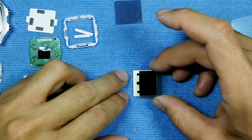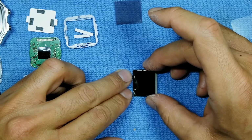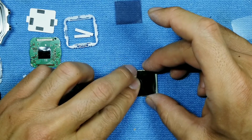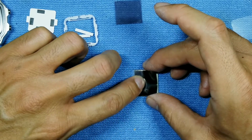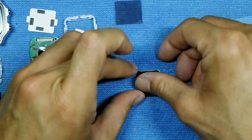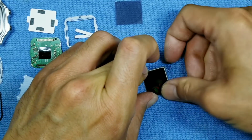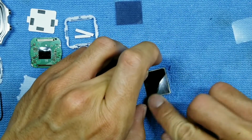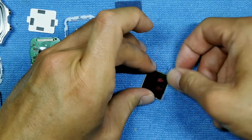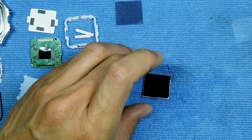Okay, take your polarizing film, drag it all the way to one side as far as you can go. And then once you reach the top, roll it over from one end to the other. Okay, apply nice firm pressure inside to outside. Kind of work off any air bubbles that might be in there. Okay, take another Q-tip here, clean one.